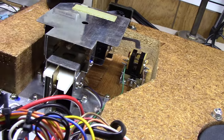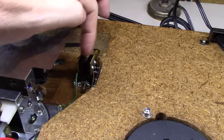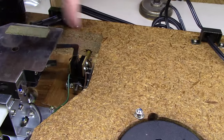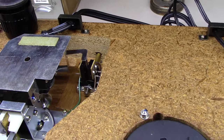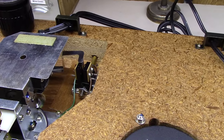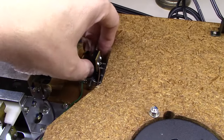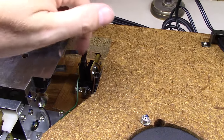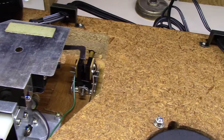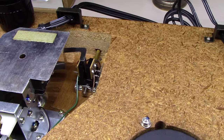There are just two more switches up under here. The good news is you can kind of bend the little red hose on the Deoxit and spray these without taking them loose. Usually you don't do anything with this little optical sensor here that senses when there's a break as the arm swings by. Be careful — never, ever get Deoxit in that. It's got a little LED or something that shines light through, so do not get anything in the way of those two.